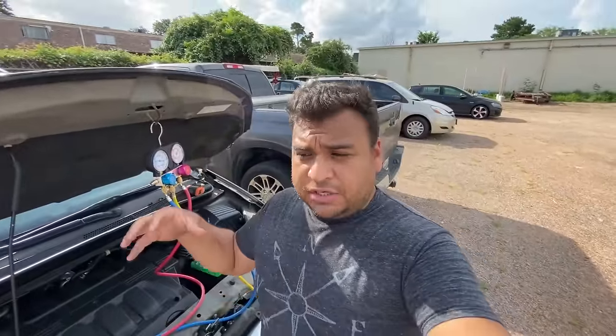So there you have it — I'm going to tell them to replace the AC condenser, and I'm also going to recommend they flush the lines while they're at it. Fast forward two days: I got a phone call from the shop owner telling me that everything was good after they replaced the AC condenser. I also wanted to go over why the discharge line was getting cold — we saw condensation on it and measured it down to about 60 degrees near the expansion valve.